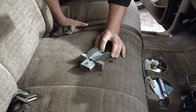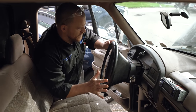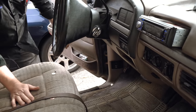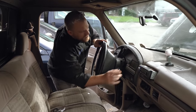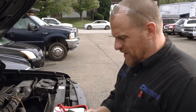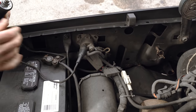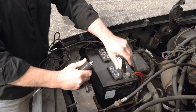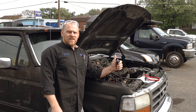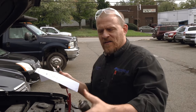I don't know if that needs to be grounded on the backside to function. It certainly needs to be grounded and put there for heat distribution. I'm just turning the key on, making sure I'm in park. I have this little remote that I can hook up to this starter S-post — go to battery positive with that — and then stand over to the side in case it's not really in park. When I hit this, I can crank it. That's just the starter solenoid on a Ford.